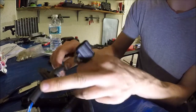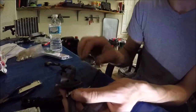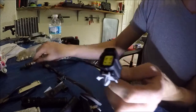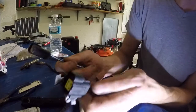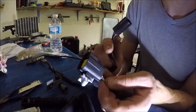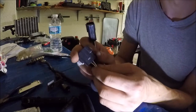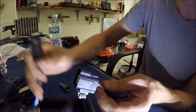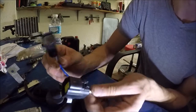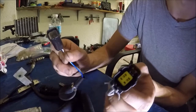What we're going to do is take this rubber boot off — that comes with the grommet — because we want some insulation. We're going to slide it over the upstream sensor that we bought online. Then we're going to cut off the pigtail and solder it onto the downstream pigtail. We should have a great cheap O2 sensor that's fully functional, helping us get better fuel economy and not run rich or ruin our catalytic converter. The only tricky part is there are four wires, so you want to make sure you align them correctly — that's the trickiest part of this entire process.